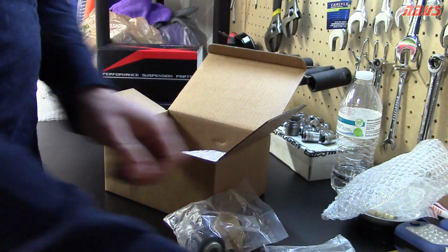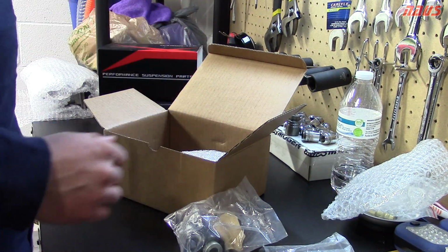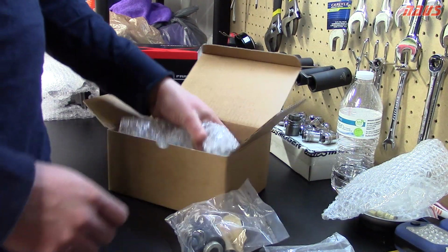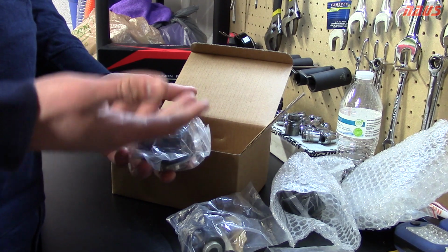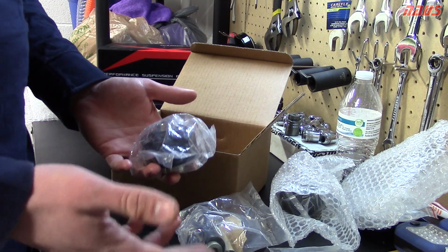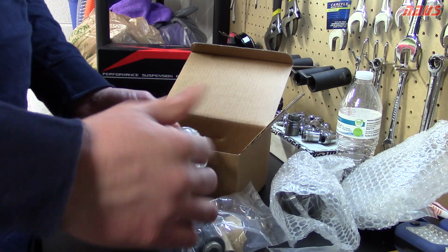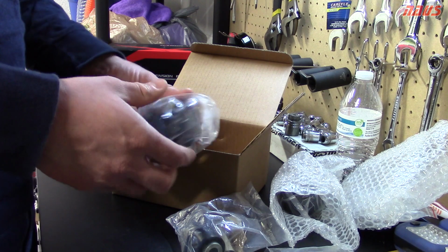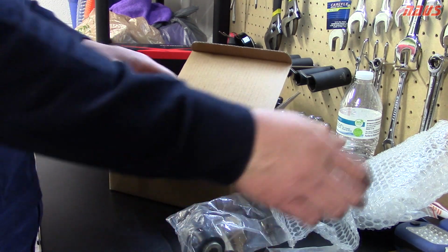But the main reason I wanted Hard Race versus all the other ones available was that the one downside to running spherical control arm bushings is you get dirt in the bushing. If you look at Full Race traction balls, they're an open design where if you daily drive your car, you're going to have dirt going in between the bearing and contact surfaces where it rotates. So I really didn't want to do that for that reason.